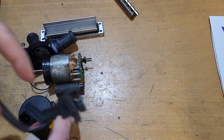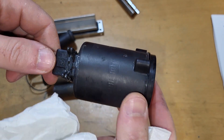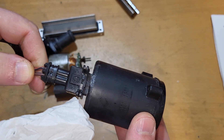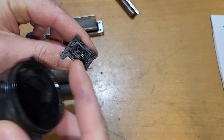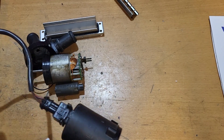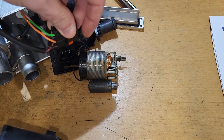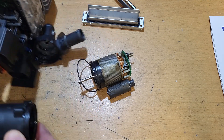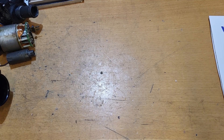They connected the harness to the pump and probably left it like this overnight. Here is the really interesting part which I find so hard to believe: we had two bars of pressure, and there is a seal on the connector. All the water coming out started to migrate along the wires. Both ends are sealed — here at the pump and also on the ECU there are seals in the connector where the cable goes.